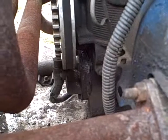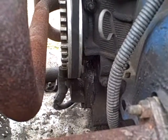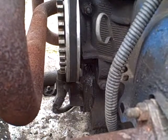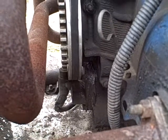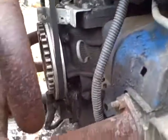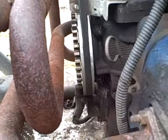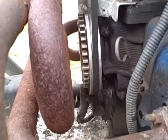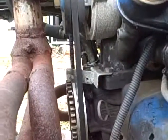Worry about your alignment. The trigger wizard in Mega Squirt can correct for a lot of sins in this respect, but it's best if you get this thing aligned within a degree or two. It just makes things start up a little easier because your timing is in some way determined at startup without the trigger wizard. I did it all by hand on a drill press, was really careful, and managed to get it within about a degree. So it's possible to do with homemade stuff without fancy tools.